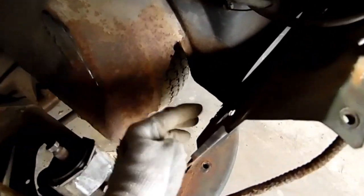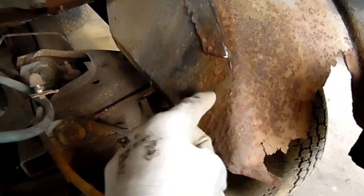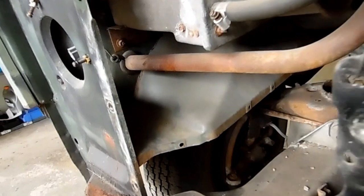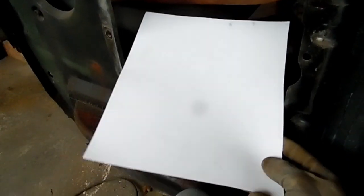All right, so we got that piece removed completely. This whole section might get cut depending on how badly pitted this area is. I might be able to come up into that, remove the rest of it, and eliminate all this. Getting the template off the opposite side might be easier now that I see it. You're just going to lay your template in here — I cut a piece that fits it well enough. The lip ends right there and goes the full length. It'll set on top of this lip flange here and conform to that.